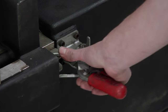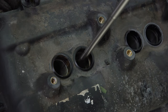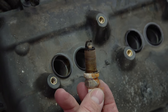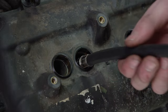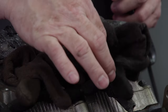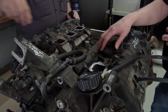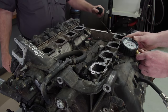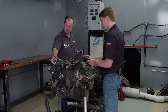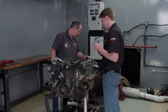Wiring harness — who needs that kind of stuff? The first thing we do to any salvage yard engine is to pull out the spark plugs and check their condition. These have some rust on the threads and some carbon deposits, but overall not bad. Another test we will do is a cranking compression check. This can tell you if the piston rings are in good shape and if the valves are sealing up. It's like 220. Not bad — that's good. Let's do the rest. There's no clanking or anything, so check the rest of them.